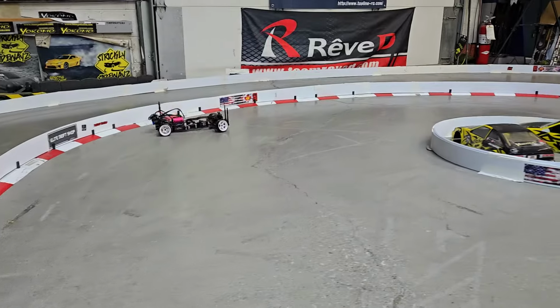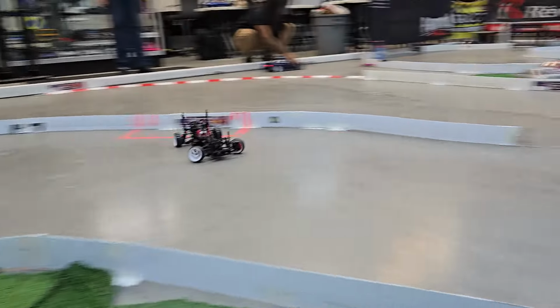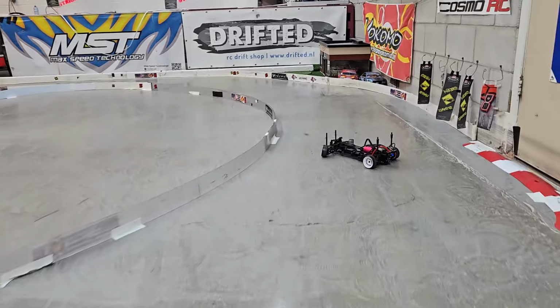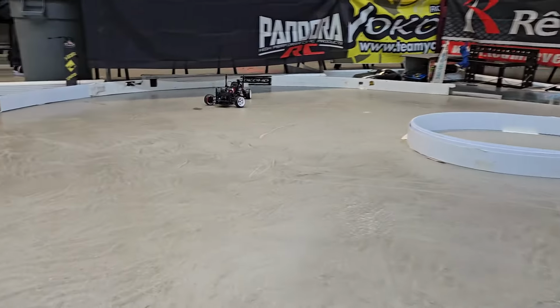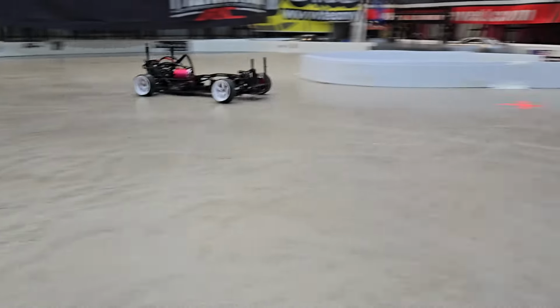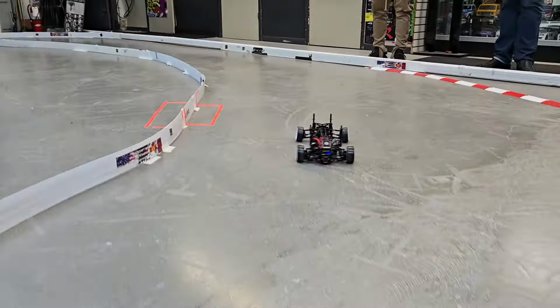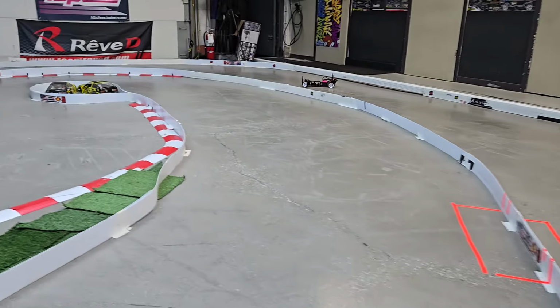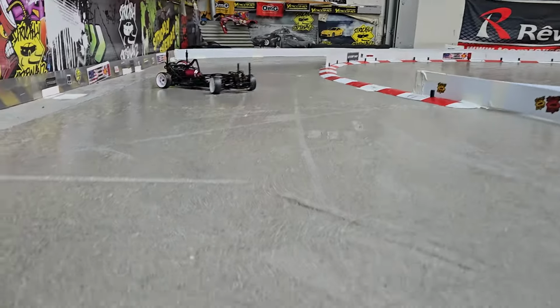And they're like, "Did you tune this car?" And I said, "No. Again, this is the factory settings, straight from the manual." I didn't tune anything other than the shock preload collars, because there was no setting for that in the manual. So I gave it my setting there. I think I put 2.5 millimeter in the front and about 4 millimeter preload in the rear.